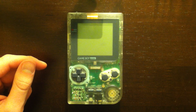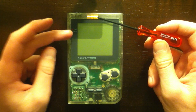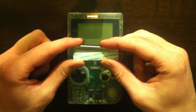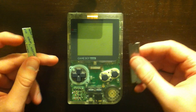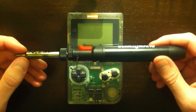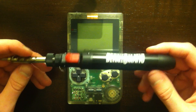You're going to need some materials to do this. To start, you're going to want a tri-wing screwdriver — these can be bought online for a few dollars — to actually open up the case. When you get inside, you're going to want a small Phillips head screwdriver. And to remove the back layers off of the screen you'll want a razor blade so you can get it between the layers and work it off. You're going to want a soldering iron. I like to use a gas powered one — they're not as bulky as electric ones, and the cord doesn't tug the iron or knock other stuff around.